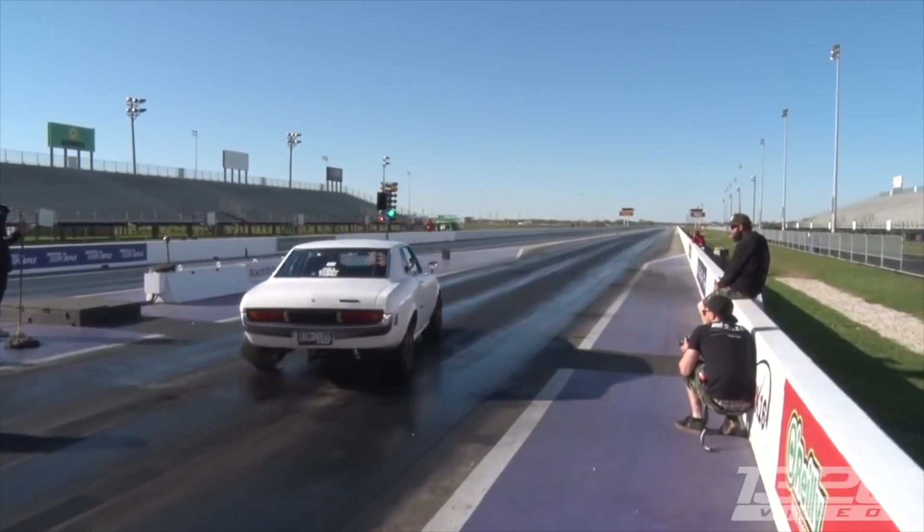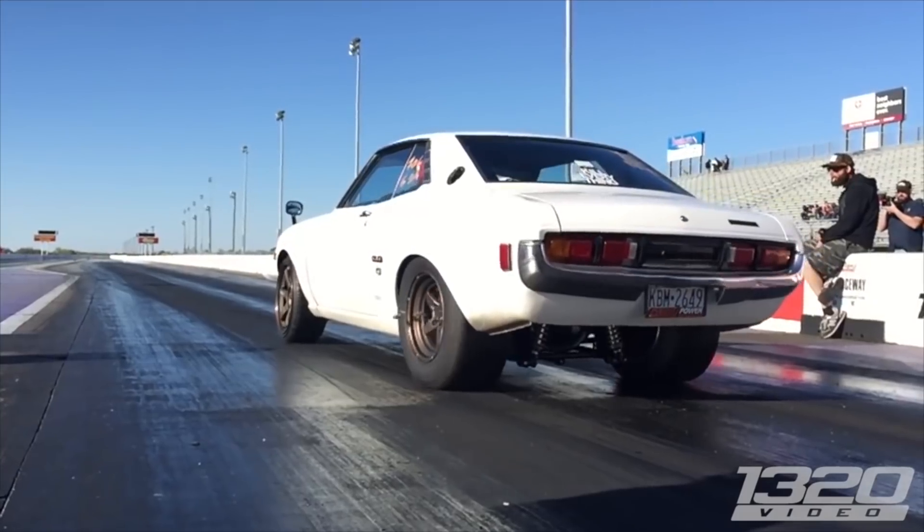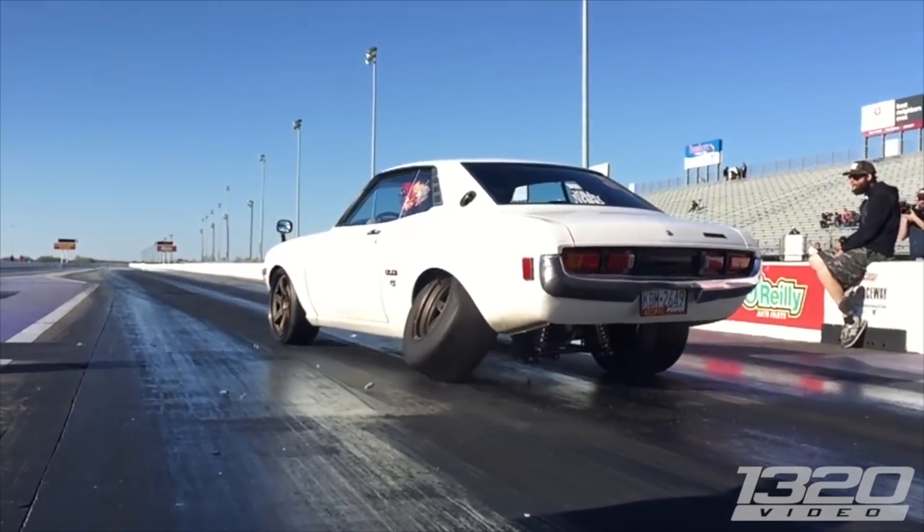This is their Fury model, which is a higher-end one. It's actually very powerful — it can control a 20B three-rotor motor or a six-cylinder engine, so it's kind of overkill for our Beams, but I wanted room to grow if I get stupid and want to throw a 1J or 2J in there. It's also got motorsports-oriented features like traction control and even cruise control. It has a built-in digital wideband reader, so literally just run the wideband to the harness and this thing will already have full control via the wideband, which is pretty awesome to have built in.